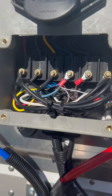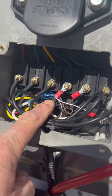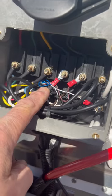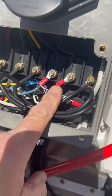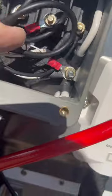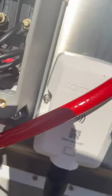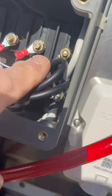You open up the box — there you have it. Right in the center there's blue, your ABS or constant 12 power if the tractor supplies it. There's your brown, that's going to cover your marker lights. In the corner we have white, which is ground. We have ring terminals on all of these — we're using good crimps, and they're all at the same angle as the OEM.